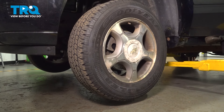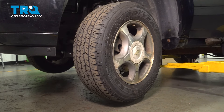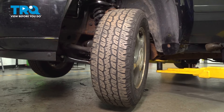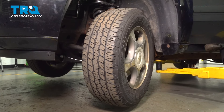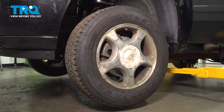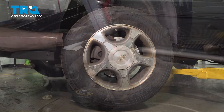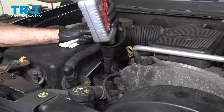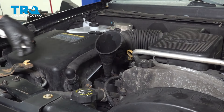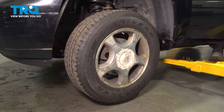Let's get the key in the on position. Now we'll start turning the wheel slowly all the way to one side, pause, and then continue all the way over to the other side. This isn't a race — all we're trying to do is burp out any air in the system and allow fluid to make its way down and through. Keep checking on that fluid as we continue and top it off as necessary. Repeat this process as many times as it takes to remove as much air as possible, because starting the vehicle with air in the system will create air bubbles and cause an issue.